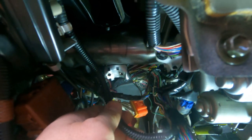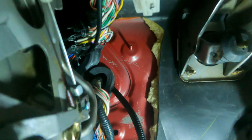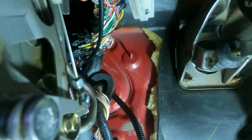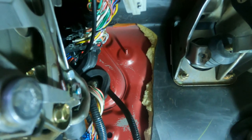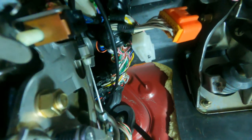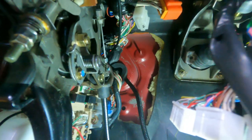I've gained access to this bracket up here and have taken some pliers and bent it that way. I've started to test fit the pedal in this area — you can see all the scratches on the firewall. That stud sticking out is going to be approximately the center point of where your clutch master cylinder will come through the firewall, so that's a good spot to aim for. I've moved a lot of the wiring and taped some up to protect it. It's quite the mess in here and it's a tough job.